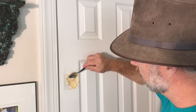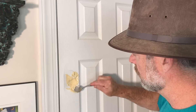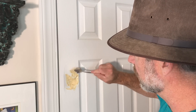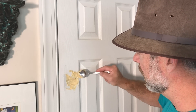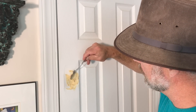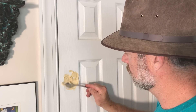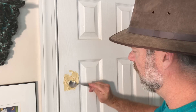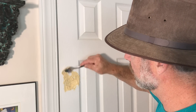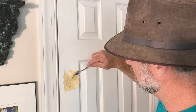I'm just going to force the material into the cracks so that it anchors in there nicely. You don't need to do a whole lot with this first layer - you don't want to get too thick because you want it to dry and then add your next layer. Rome wasn't rebuilt in a day. I'm just pushing that into the hollow of this area; I'm not going to try to build it up right away. Don't use this excessively because when it hardens, you don't want to sand off a bunch of build-up.